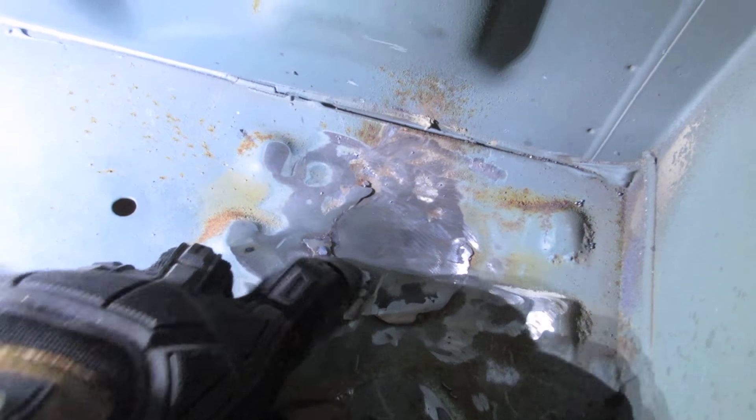I have started welding finally, and I realized I am a really poor welder. I started here — had a crack, welded that up, still need to bang out the dent, but that'll hold the booster just fine. Then I cut out the roll bar that was on this side, and when I was grinding down the bottom part I found a nice little soft spot. I had to patch that, then kept burning through it, and had to run welds to cover the holes. I finally got the last pinhole welded up.